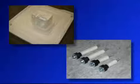If the bolts are not removed, or the block is stuck to the bottom of the tub, the customer will experience excessive vibration and the support block will cause a squeaking noise.